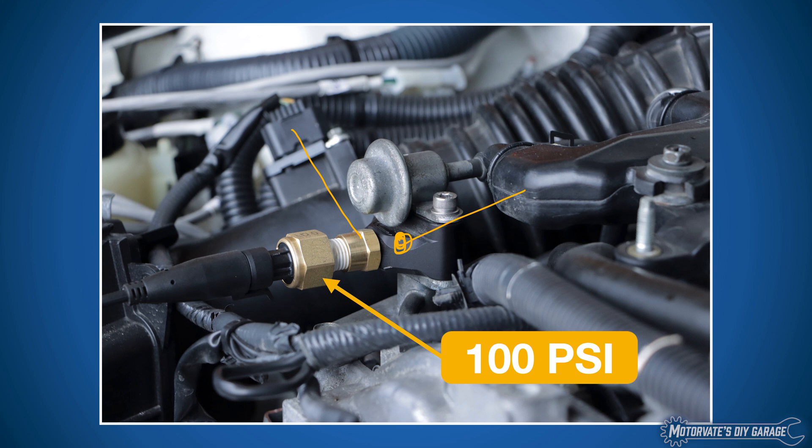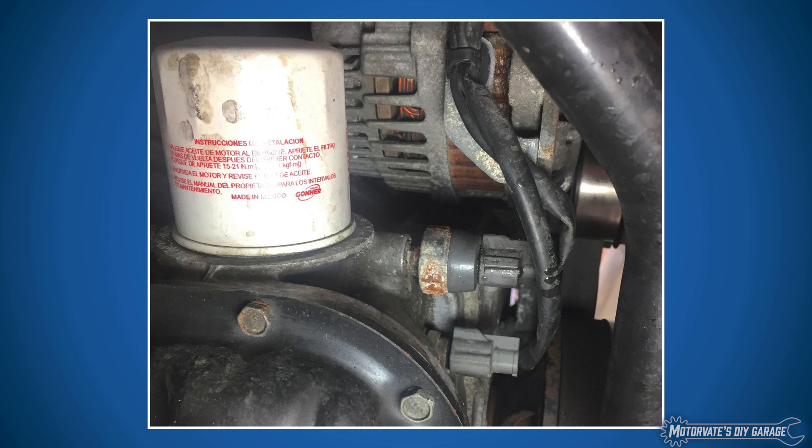The last item, and this is the big one for VHR guys: engine oil pressure. Here is our engine oil pressure switch on a rear-wheel-drive G37 or 370Z. This switch is not all that useful — basically, if the pressure of your engine oil is less than five PSI, it turns on a light on your dash. But by that point you've already got damage to the engine. Just to help you orientate: that's the oil filter, and on rear-wheel-drive cars it points towards the passenger side. Here is the engine oil temperature sensor, and there's our crank pulley with the accessory belt and an idler.